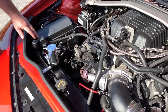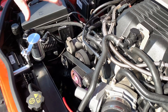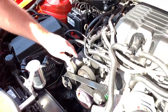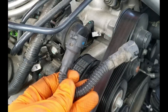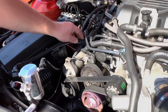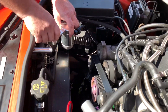What we have here is the new four-stage separation can for the ZL1. It's angled in this manner so it clears the extractor scoop on these cars. You have your dirty line and your clean line. The dirty line comes off a small looped line normally here from the factory that loops from the valley to the supercharger inlet — you release that by taking the two little tabs off the factory fittings. Your dirty line goes into the catch can, and your clean line comes out with a check valve back into your supercharger inlet. Real simple install.